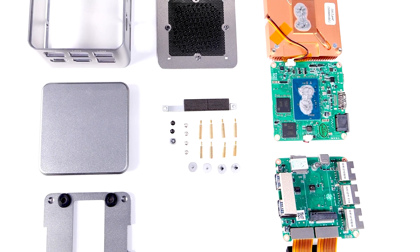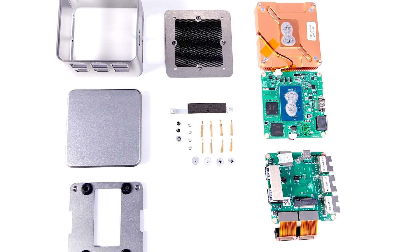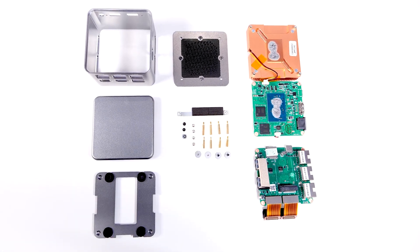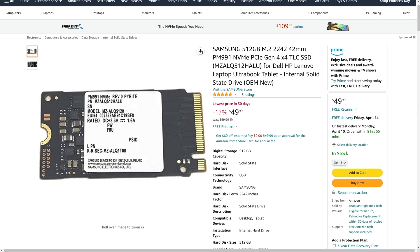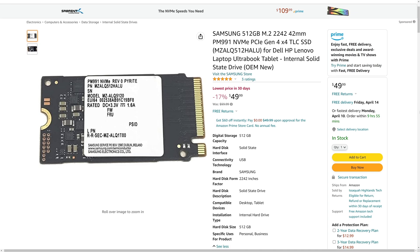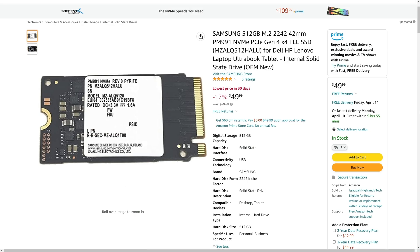Here is everything all separated. This is quite an innovative design and smartly laid out, maximizing the amount of hardware in a compact package. We're going to install a Samsung PM991 512GB NVMe disk. This unit supports an M.2 2242 NVMe — the 2242 is shorter than the typical NVMe disks you've installed in a PC at home, but they're just as fast and functional. This unit supports up to 2 terabytes if you can find one.